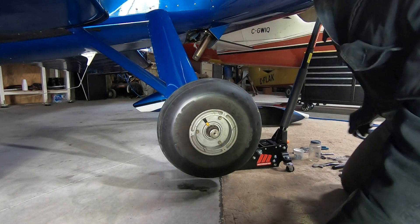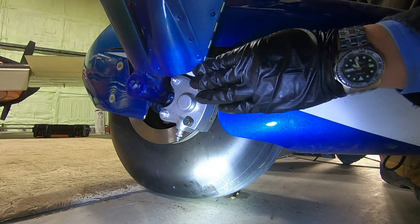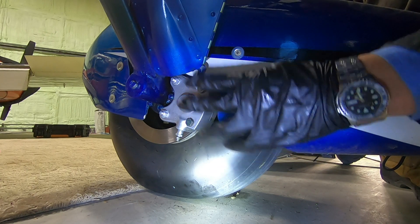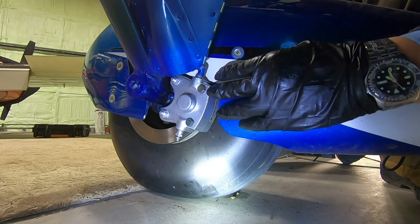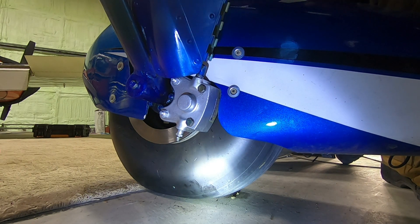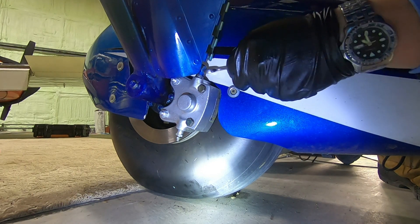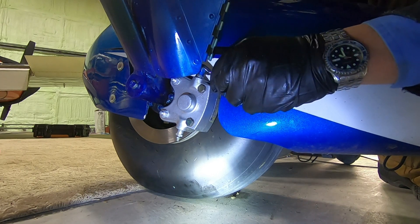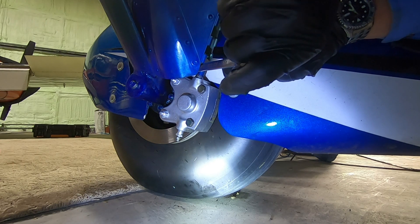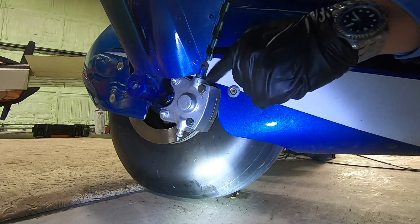We'll lower this onto the ground and put our wheel pants back on, then get into that brake. Each airplane is going to be different in the amount of access available. The Acroduster is very tight here with a hard line coming into the end of this fairing, so I can't remove it without breaking the hydraulic line. On quite a lot of aircraft with flex lines you can get these off and change pads without breaking the line. I'm going to have to break the line here, which will require us to bleed the brake later. I need a 9/16 wrench to undo it, and we want to support the end fitting — a 7/16 should work, though an adjustable wrench can also be appropriate if the casting is awkward. We're protecting the casting so we don't get a crack.